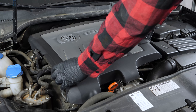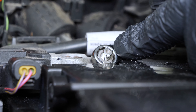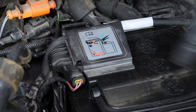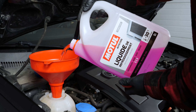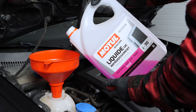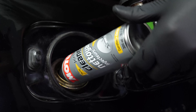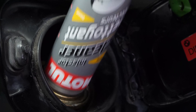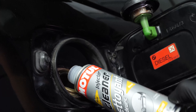Reinstall the engine cover. Reconnect the battery. Before using your vehicle, you have to put the coolant fluid back in and bleed the air from the circuit. Watch the video 'How to drain and bleed the coolant system of Golf 6 1.6 TDI'. To complete the operation, take advantage of the opportunity to clean your injection system by directly pouring injector cleaner into your reservoir, which will help avoid numerous problems linked to injection and will guarantee optimal engine ignition.